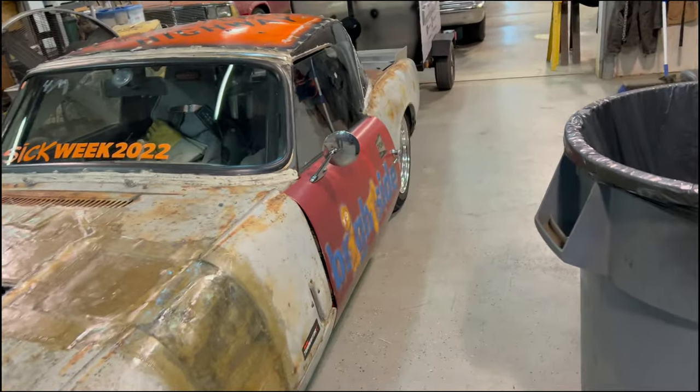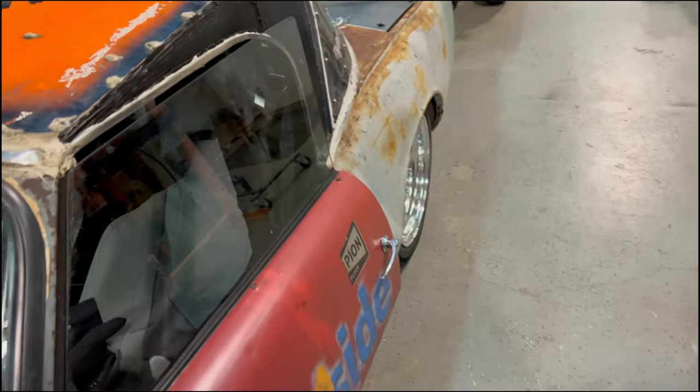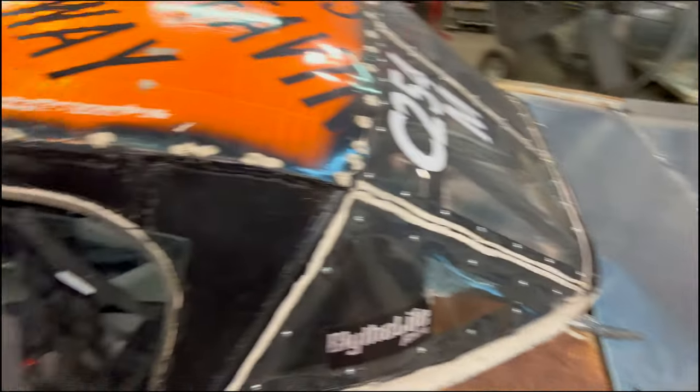Made it to the shop. There was that little hiccup pulling out of the trailer, and then driving down the road I had no overdrive — it just wouldn't go into overdrive. So I'm going to check the linkage and make sure that in overdrive it's putting that little detent in the spot where it's supposed to be on the shift linkage. Going to go ahead and get this thing on the lift and get ready to start pulling the transmission out.